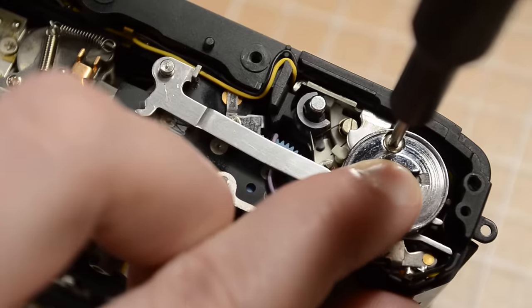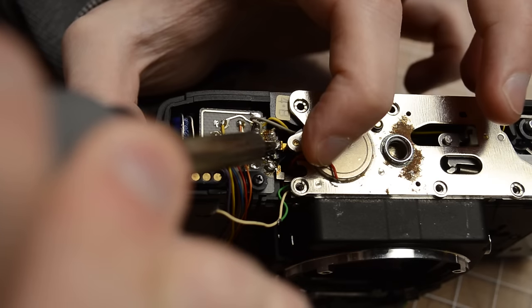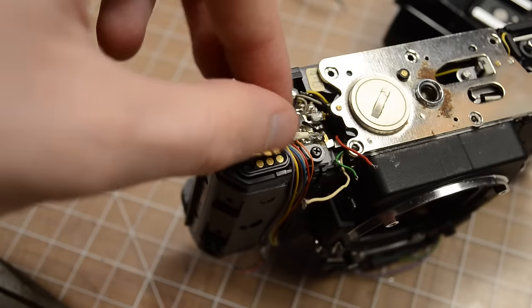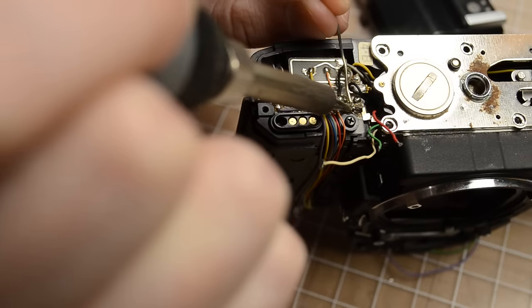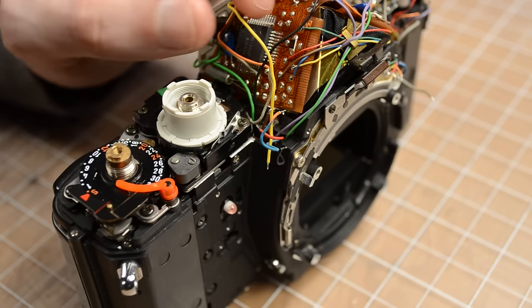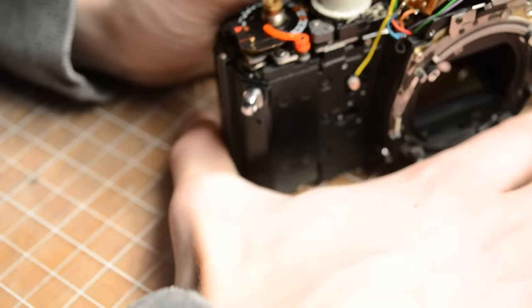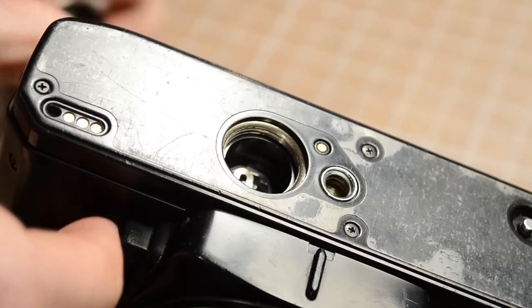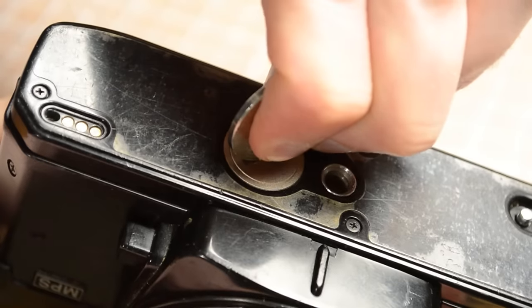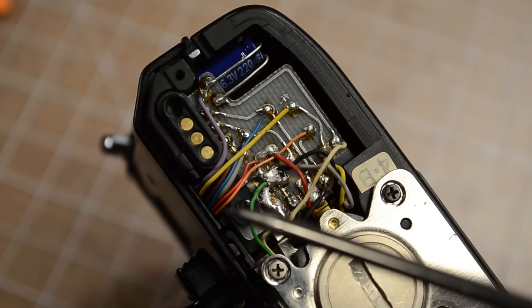With that properly adjusted, we can put the battery tray back into the camera, and we're going to have that solder pad issue to contend with. I tried a number of different methods to fix the solder pad, and there's probably a product that exists that would have done exactly what I needed, but after a number of failed attempts, I decided just to solder a jumper wire from the battery lead onto the nearest solder pad. I got 90% of the way done and then realized I missed a wire that was supposed to be soldered into the mirror box and had to completely disassemble the camera again to get it back into place. Now that we've gotten this thing back together, we can check the functions of the camera — and it doesn't work. Looks like we have no power, so I'm going to go back underneath to where the solder pad is and, as any self-respecting repairman would do, I'm going to just super glue it down to the board. And look at that — now it works again. By the way, I'm taking repairs, so if you want to send me your camera, let me know.